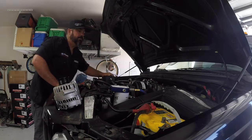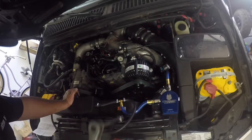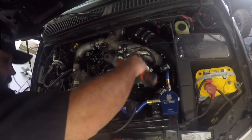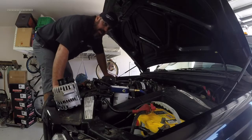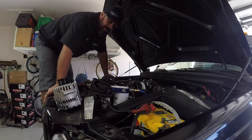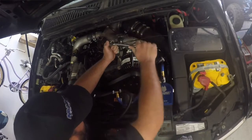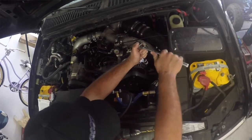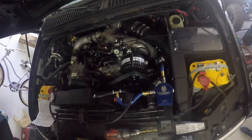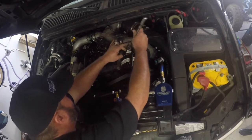Now that we have our belt on, I just want to look quickly and make sure that everything aligns properly. Once we do that, go ahead and tighten up the bolts. If you're using an electric tool, one of the things you're going to want to do is just get a regular ratchet and put your hands on it — just make sure that everything feels good, nothing's too loose or too tight. Once you snug up those bolts, go ahead and snug up your wire, which is the 13mm, to the new Mean Green alternator.